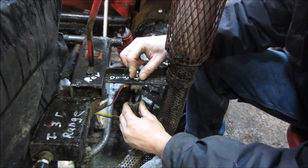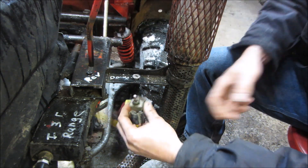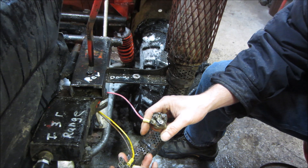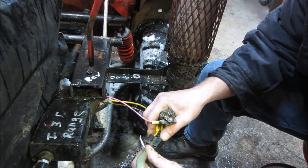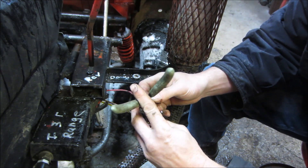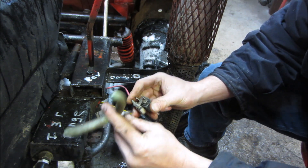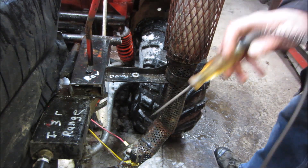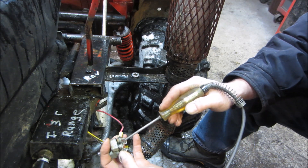I don't know if we lost power going to it or if the switch itself is no good. It's got a resettable fuse built in — yeah, so that's power coming in. We just have to put 12 volts down either one of those and it should go one way or the other. Let's try cheating a little bit and prod that. We get nothing — I wonder if we lost 12 volts coming over here. Let's try the other side. We'll grab a test light and see if we've got 12 volts still coming over here. I have the test light hooked to the negative of the battery — went across the battery to make sure it's still working. We got nothing coming back here, so we lost the power source coming in.